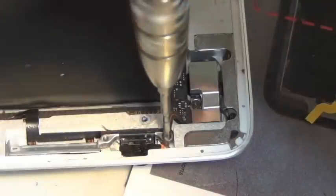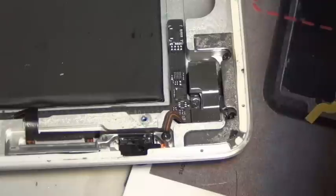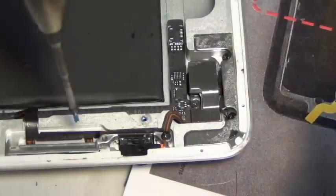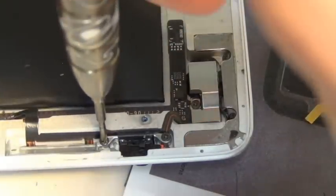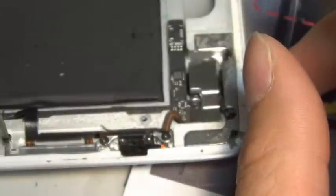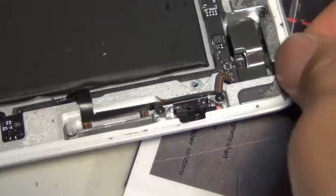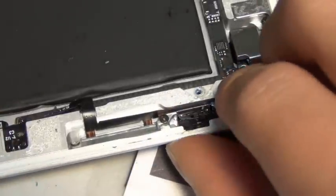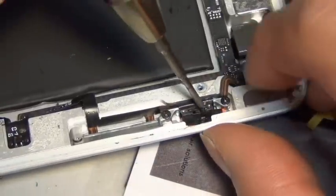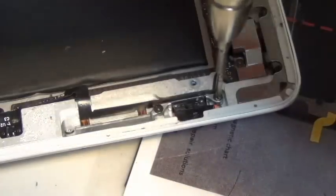You don't need to worry about magnets damaging any iPad or iPhone or any Apple product. First of all, these magnets are not that strong compared to the rare earth magnets in your iPad and magnetic case. The entire iPad is basically a giant magnet. Surface mount components don't need any magnet protection. The only thing you worry about with magnets is a spinning hard drive, and Apple hasn't had a spinning hard drive since the iPod fifth generation video. When it's off, you can put as much magnet on those things as you want.